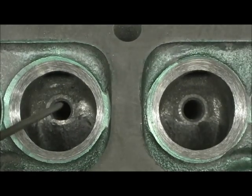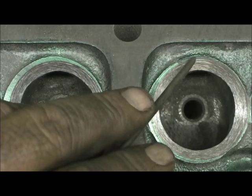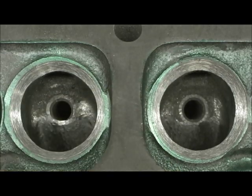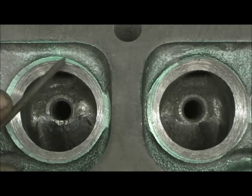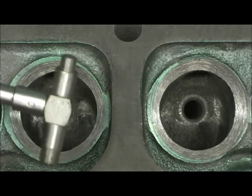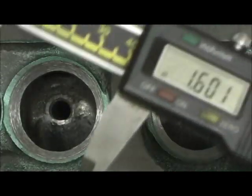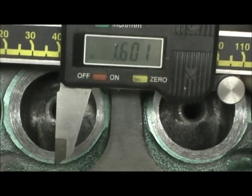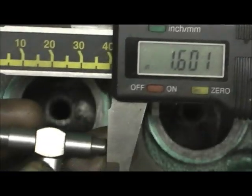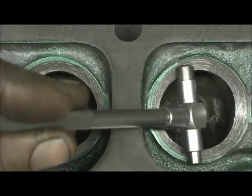Let me see if I can get down in there — that's about as good as I can get. Both of them are 60 degrees all the way from right here to here; up here it's probably 10 or 15 degrees — that was the kind of pad that the 882 heads got. As you can see, it totally takes that out. This diameter right here all the way to here is about 1.60. I took this snap gauge and my caliper — 1.601 — all right.